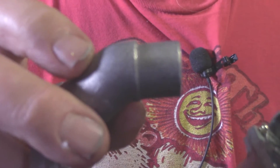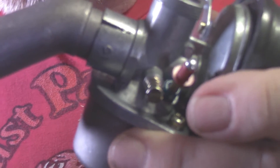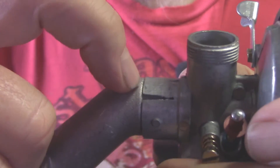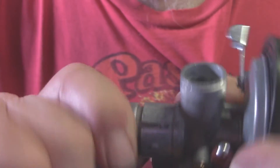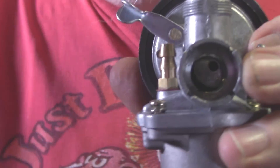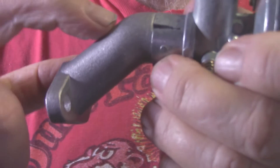Here is a cast intake that has a shoulder on it. You can tell when it's fully pushed on because the carburetor throat is almost touching that shoulder on the intake. Some people say put an O-ring in there to eliminate the possibility of an air leak from that area. As long as you've got the carburetor pushed in firmly and clamped tight, you're good to go.